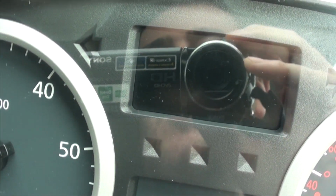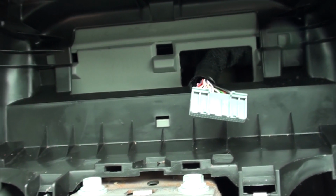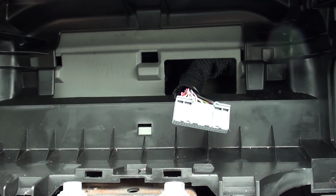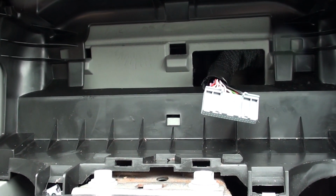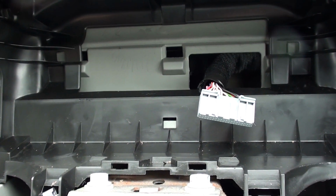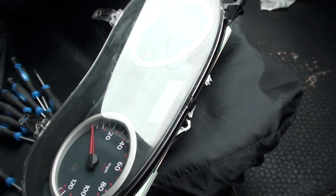And I don't know, man, I'm not going to hold out much hope, to be honest with you. I personally think it's a problem with the fuel sender, or the float, possibly. I don't know how it can be, maybe stuck or something. It won't be stuck really, unless it's stuck a bit and it moves a bit, which registers. But there's definitely something wrong somewhere. But, yeah, we'll see what happens. Like I said, I ain't holding that much hope with this. But we'll see. Hopefully they do reset when you unplug them.